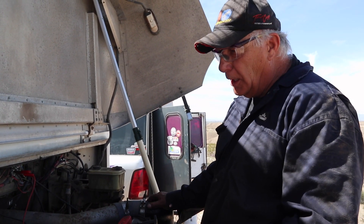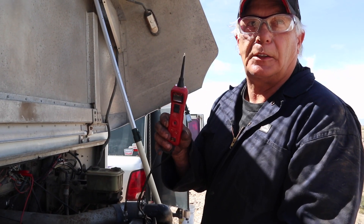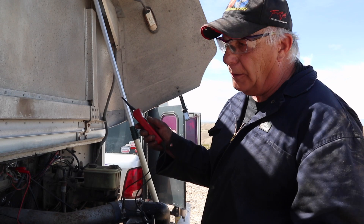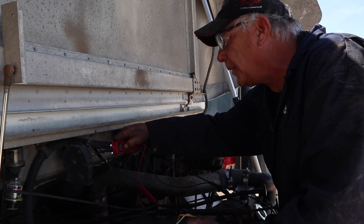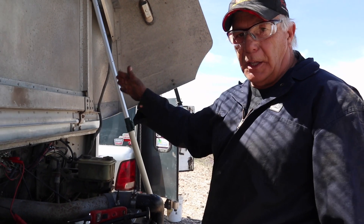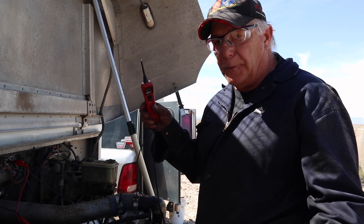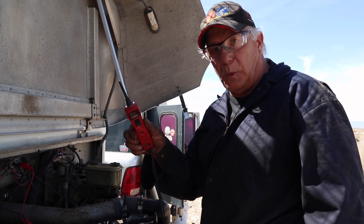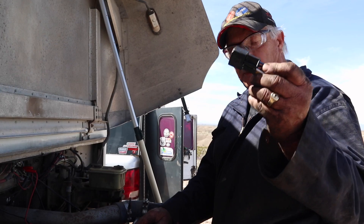We've still got six hours to burn, so we're tackling the horn that doesn't work. I've got one of these power probes — greatest little tool you can find. It puts power right to your fingers so you can test components directly. I put it on the horn and it works, so we know the problem is between the horn and the steering wheel. Leave the horn alone. This tool works for light bulbs, wiper motors, anything — it saves a ton of time.